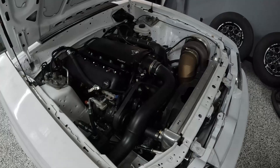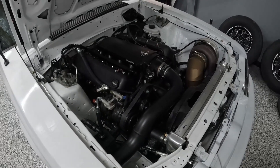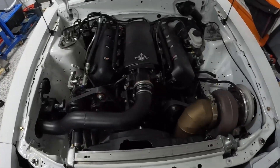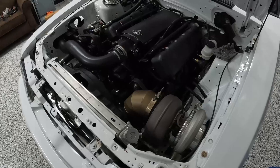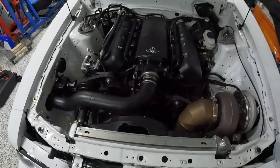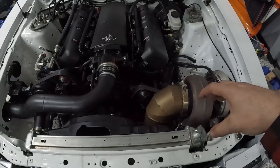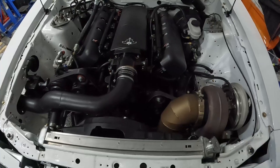There's the mid-ground argument: why not get something in between? The answer would definitely be something like the Gen 3 VS Racing 7875 — I think it's got like a 1.2 A/R. That's an awesome option because it's going to spool better than this turbo and still make a lot of power. In my particular case, if I'm only looking for 800 wheel, could I have used the VS? Totally could have. The reason I didn't: it's a lot more expensive than what I got this turbo for, and it's not readily available in Canada. Ultimately this turbo is probably only going to stay on this car for one season anyway because I want to move into limited class racing hopefully next year. I can take this off, put on an appropriate limited-class turbo, and not have to refabricate everything from T4 to T6 again next year.